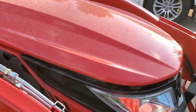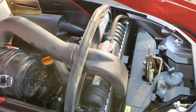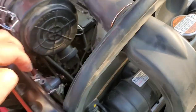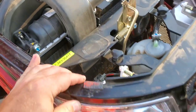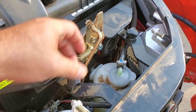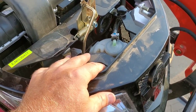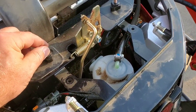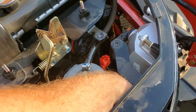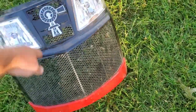And then the last thing that we ended up doing is underneath the engine cover here. Now this hood props up nice and out of the way, but everything else is really cram packed down in here. On this front plastic grill with your headlights there are two screws — here and here — just little thumb screws — and they unscrew and this whole piece slides out of the way. So once these little thumb screws are taken out and you go down here, there's a little wire clip that hooks to your headlights. Once that's undone this entire piece can lift up and move right out of the way.